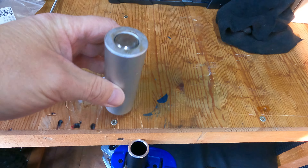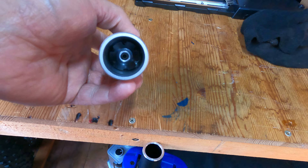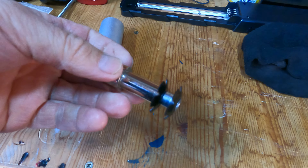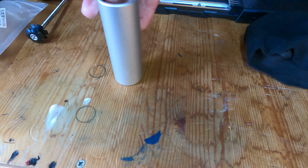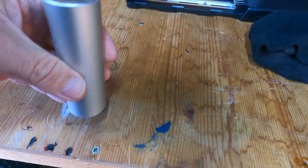Get yourself a bit of kit — I bought this piece of kit here, star nuts in there ready to go in. It's a simple piece of kit to use. Basically you just screw your star nut on that you want to knock down into the fork, then put it up in there like so, give it a little push so it's level. As you push down on that — I'll show you. The best way is I'll actually show you how to do it, it's easy.